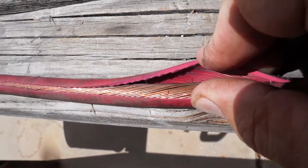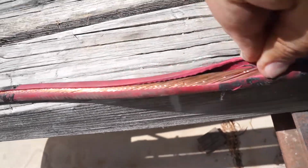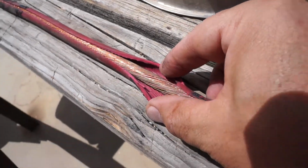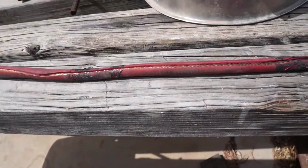I hope this is picking it up, that there's a lot of green oxidation, more so than I would have expected, given, again, the insulation wasn't nicked. This tape and stuff is where they had extra protection where it went through some cable stays or ties or rings next to the block. But overall, like right there, I hope that picks that up. I would not have expected the amount of oxidation, the green yellowish inside, but 20 years, 22 years actually, so I don't know that it's horrible.